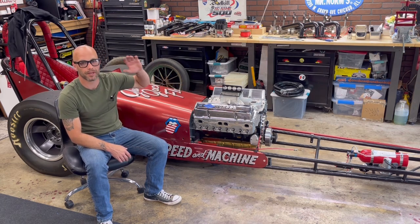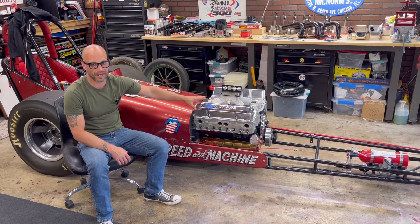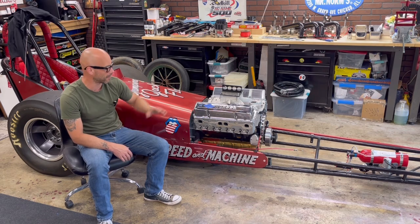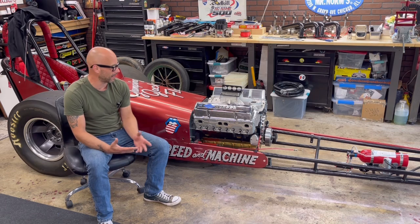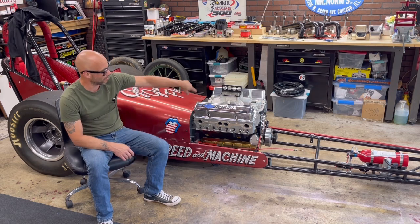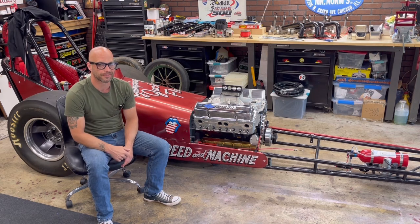The specs on it, I'm going to put a link to it in the description. It's going to work very well with the cubic inches that this thing is running, also with the cam that I chose. It's mid to high RPM, so you know, that real 3,500 to 7,000, 7,500. It's going to work pretty well with that. Other than that, guys, I'm going to be using Felpro gaskets and ARP intake manifold bolts. And I do like using a little RTV silicone around there just to make sure everything's sealed. But I'm rambling. Let me show you what this intake looks like, and then we're going to get to work.